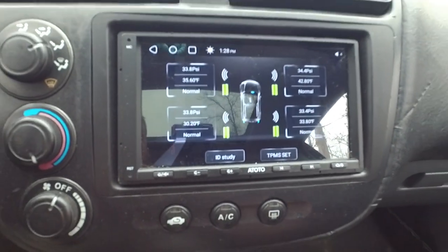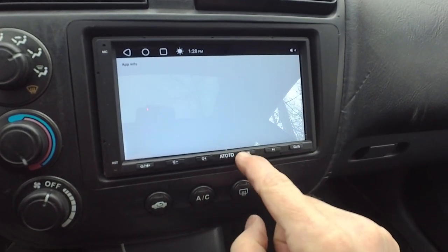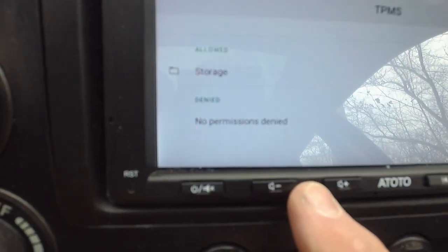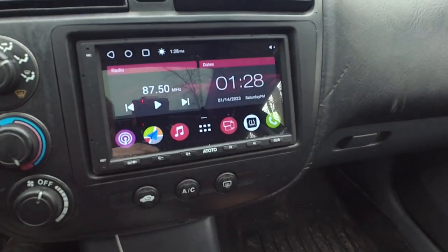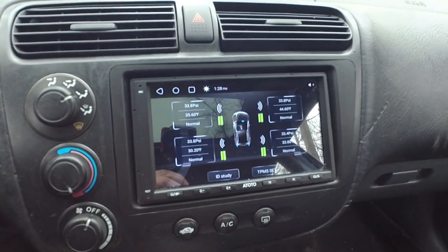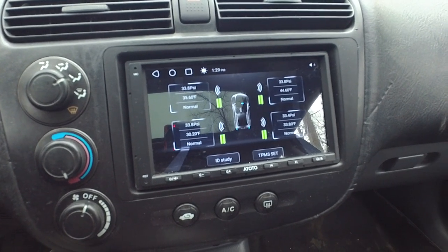Just make sure all the permissions are granted to it — that's going to be a little different on every stereo. On this ATOTO unit, go into device settings, then apps, and look for the TPMS app — it's kind of like any other Android thing. Look for permissions and make sure it says no permissions denied. It's allowed every permission it needs to start itself and draw over other apps. That's really all there is to it. I put it on the home screen so you can pull it up anytime and check the status of your tires. Hopefully the video was helpful — if it was, give it a like and subscribe, leave questions in the comments, and I'll leave a link to a system just like this that you can buy for any car running an aftermarket Android head unit.